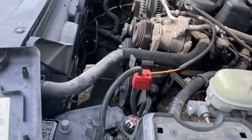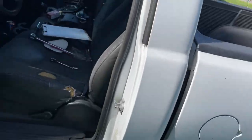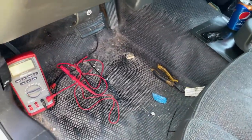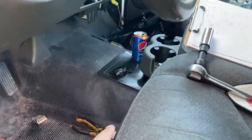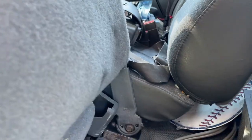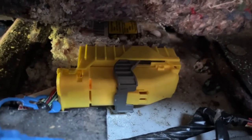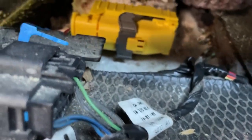That's only part of the diagnosis — I had to confirm it. I put the airbag fuse back in and located the SDM, which is the sensing and diagnostics module for the airbag system. It lives under the seat — keep the seat forward. There is a TSB about this. If you live in the rust belt states, like from Indiana north, there's a TSB. And you can see — that's the SDM, and it smells like chlorine in here.